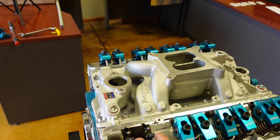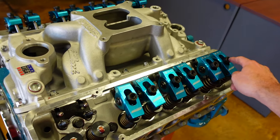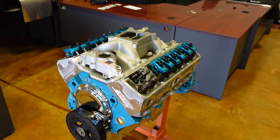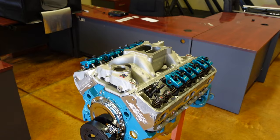We know this is a hydraulic roller engine, so we're going to be adding preload to the lifter — meaning we're going to collapse the lifter just a little bit by tightening these rocker nut adjusters on top. Different lifters will have different preload amounts, so always consult the manufacturer of your lifters. If it's a short travel lifter, you're going to run very little preload, maybe only 30 thousandths. If it's a full travel standard lifter like this engine, we're going to run about 70 thousandths of preload. A good rule of thumb is to run half preload of the total plunger travel — so if your plunger has 200 thousandths of travel, run 100 thousandths of preload.